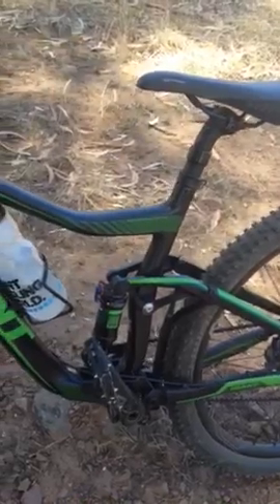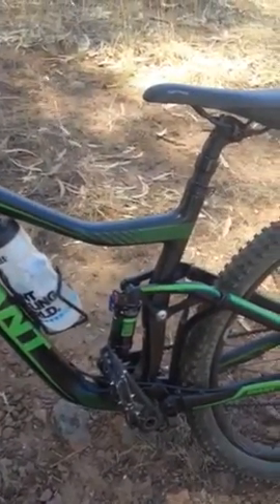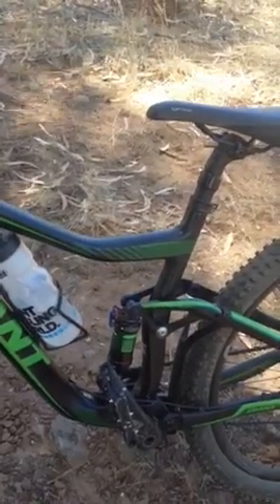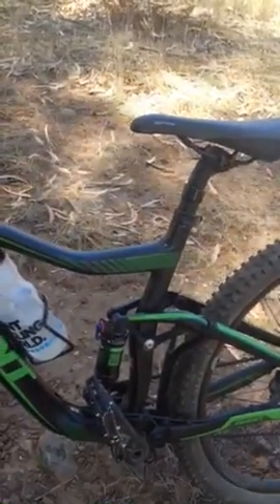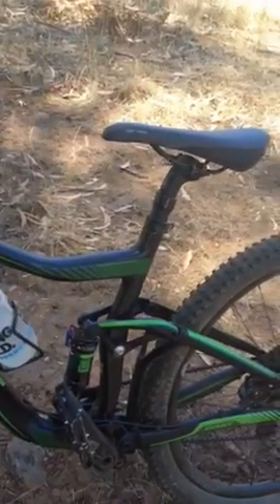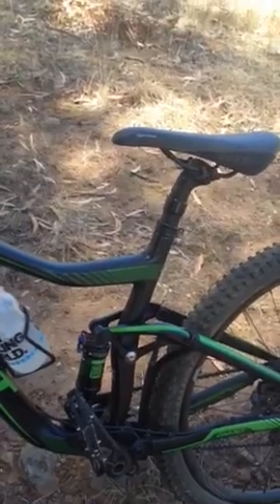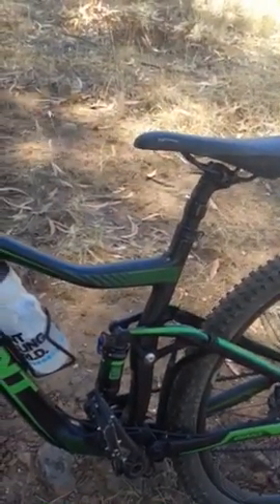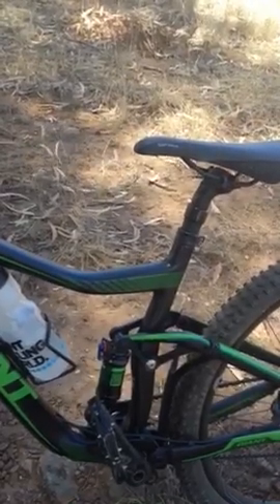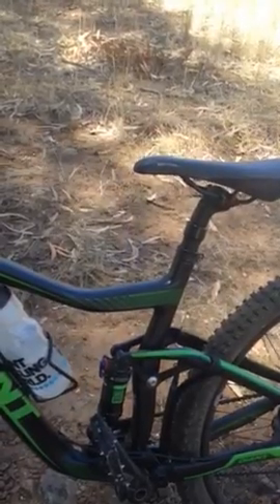105 to 110 at the back, sitting at about 40% sag. Sounds like a lot but once you get this thing going it definitely doesn't wallow. If I ran mine at 40% sag it would be real soft and sluggish - just not the case with this one. It's very very stiff, you feel everything. Being a carbon frame it's very whippy - playful as hell.